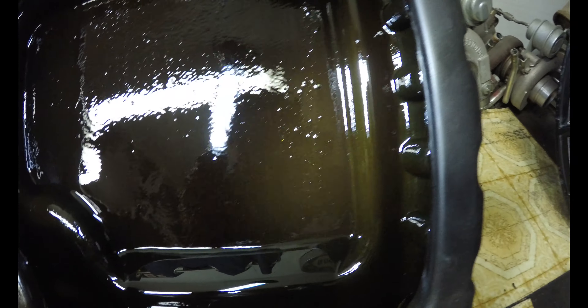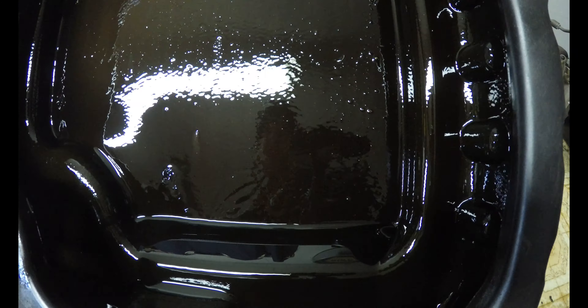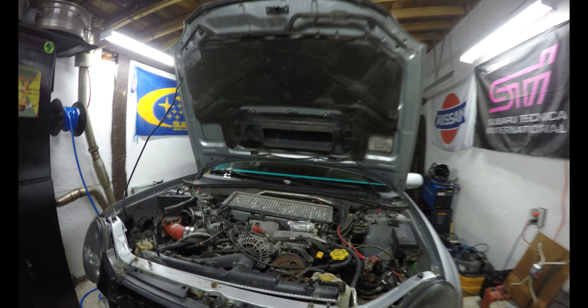You can see quite a bit of glitter in the oil as it's coming down the drain pan. Yeah, quite a few sparkles, a few bigger chunks over here. That piece of wire is just stuff previously in the pan, but I'm looking at the stuff really down in there, sticking to the pan.